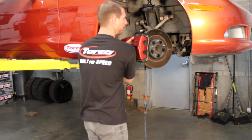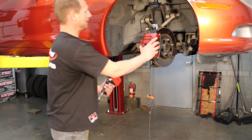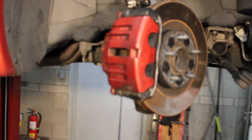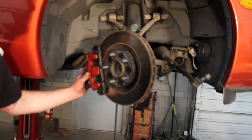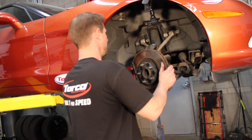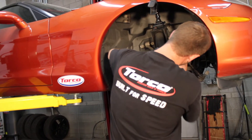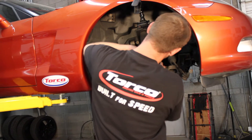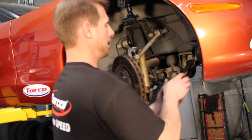Look at those angles — wow, that brake line needs to be longer. When we go to our extended upper and lower arms, we can address that. But that's quite a bit more angle than before. We've got everything on, it's all nice and safe. We just have the brake line issue, and for the wheel speed sensor we're not going to connect that yet because we actually need to bend this bracket out of the way to get it connected.